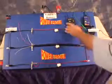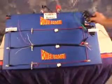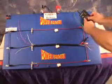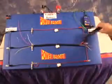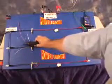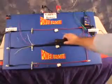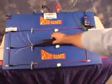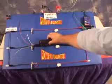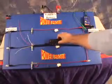Now, pay close attention here. Let's turn on the smart receiver and detect the open circuit signal. Now, lock the reception sensitivity by pressing the power sensitivity lock button. As we trace the wire, we pass right over the open switch, and the open circuit signal continues to transmit along the circuit way past the break. The open circuit signal is capacitive coupling into its neighboring floating wires, and they're transmitting open circuit signals too. This condition makes it difficult to detect the break in our circuit.